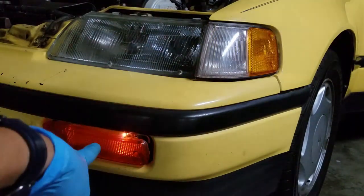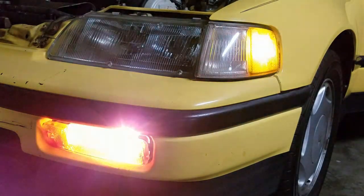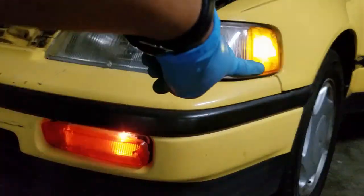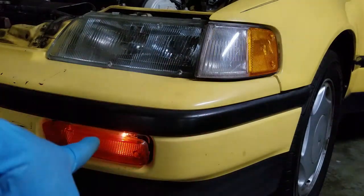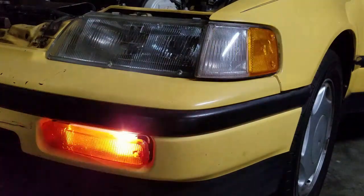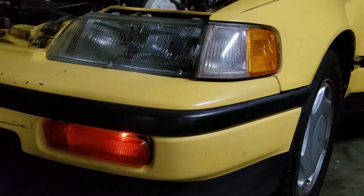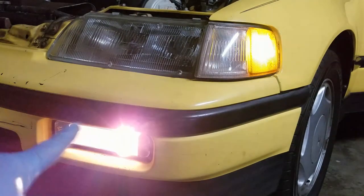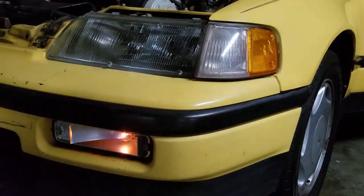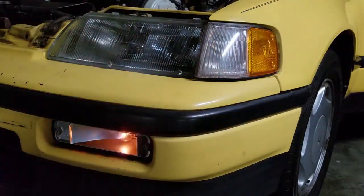What I did here is went back and replaced the 1156 LED bulb with the original bulb, then tried the turn signal again. This one is still the LED bulb and it looks like it went back to flashing at its original flash rate. Something about putting an LED bulb in the 1156 position really changed that flash rate. I wasn't too crazy about how fast it was blinking, so I went back and replaced it with the normal bulb until I figure out why it flashed so fast. I'm going to use these 1156 LED bulbs for the rear turn signals instead.